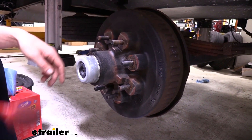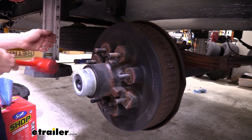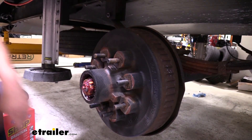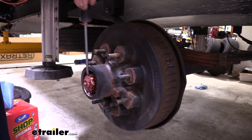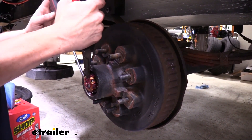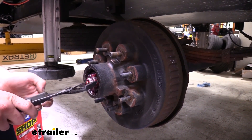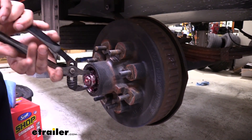The cap located here needs to come off first. It just taps off — we're using a dead blow mallet, but a rubber mallet or anything like that will work fine. Just tap it away from the face and you'll see it start to rock out and then pop off. Once you've got that out of the way, there's a clip behind it we need to pop out. A flat bladed screwdriver works pretty good, and to help minimize the mess I like to use needle nose pliers to take it the rest of the way off. Below that we have our nut — just grab it with channel locks, it's not very tight, and work it off.